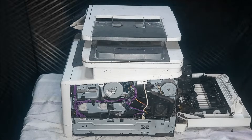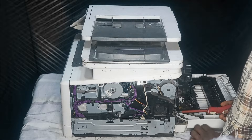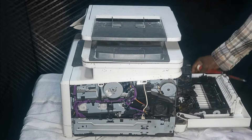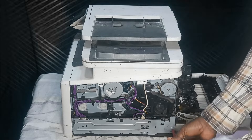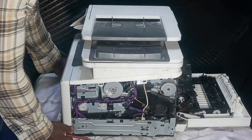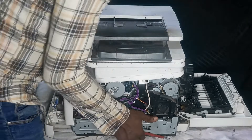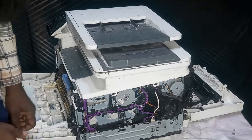The first thing we do to get access to that solenoid is to remove the power board. Remove the screws on the back side that are holding the power board to the panel. Then there is another screw here. Now we are going to remove the tray so we will be able to remove the screws. Then we remove the front cover also — there is a screw there that is holding the power board, right here.